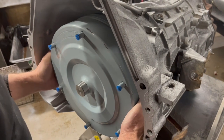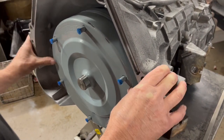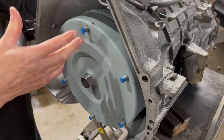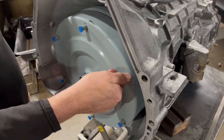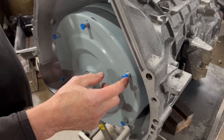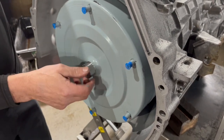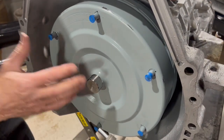I'm going to back it back out a little bit here. It went in nice and tight. When you hear that, you're all the way back into the pump and you're ready to install it up in the truck. It comes with these little safety tabs on it so you don't ruin the studs during shipping. You might want to put a little grease on the back of this pilot before you put it up in there, and then you'll be ready to install.